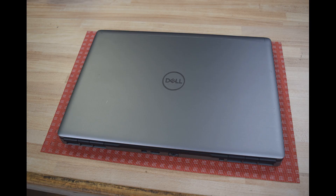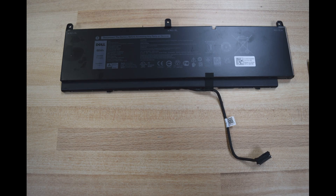Hey, Fred from the Laptop Barn here. Today we're going to go through the steps necessary to install a new battery in a Dell Precision 7550 laptop. The battery we are replacing is a model C903V. Another model that works is a PKWVM — those are 68 watt-hour versions. I buy them right on eBay in the $30–$40 range.